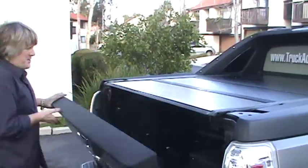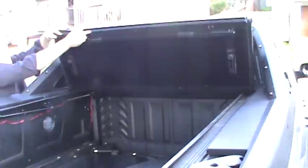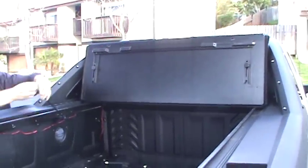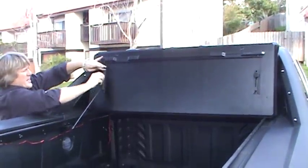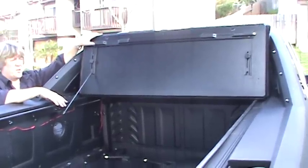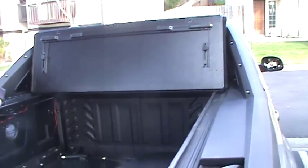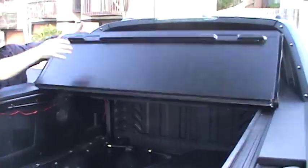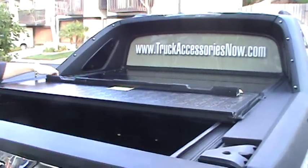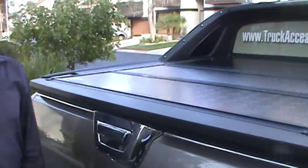It took us 30 minutes, give or take, to put this thing on. Had to drill a couple of holes, but nothing very major. We did open up the rails nicely. And the nicest thing is it's easy to open this thing up — flip, flip — folds up against the sail panel, with the prop rod and its retainer on the back side of the cover. Attach them on both sides. You'll be able to drive with this at full speed in the wide open position. Finger knob there has a little retainer clip in the rail. Close the tailgate first, latch it down, and you're all buttoned up. How easy could that be?